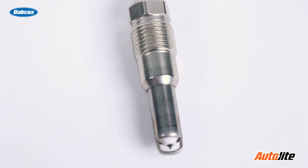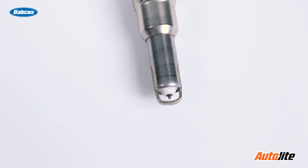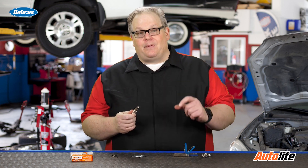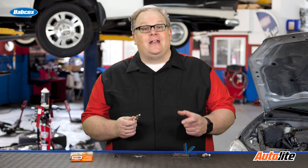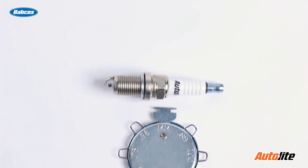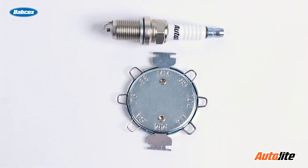For instance, this one spark plug that goes in a Ford actually has a strap over the top of the center electrode. On some spark plugs with a fine wire that have precious metals on both electrodes, gapping it with the wrong tool and the wrong technique can damage the spark plug and potentially dislodge the fine wire or the precious metal plate on the strap of the electrode.